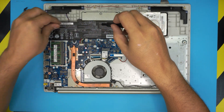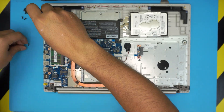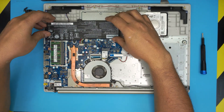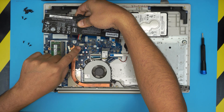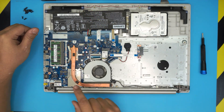If you don't have enough room to pull the cable backward, just remove the battery by taking out three screws. Once you remove the three screws, you can lift out the battery and then pull it backward so the contact comes out. You can then lift the battery to one side.